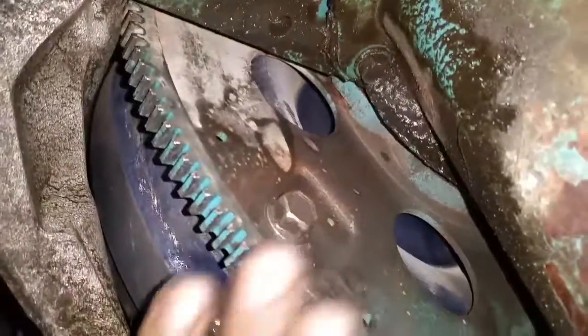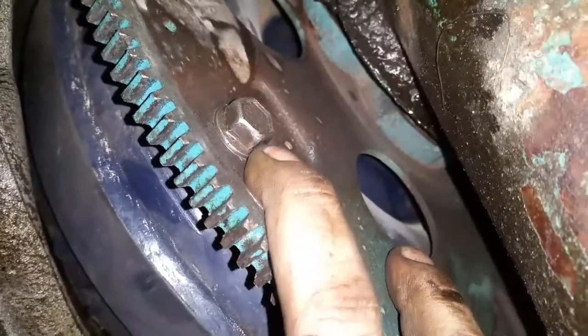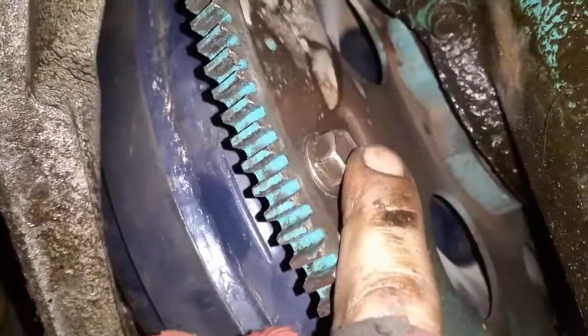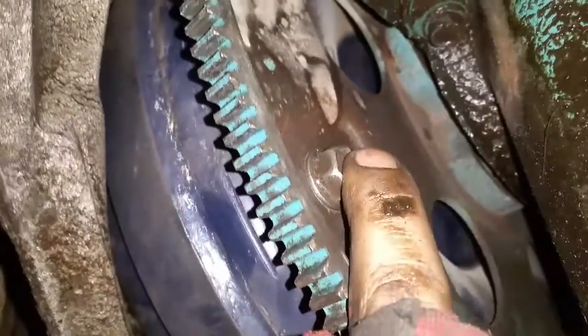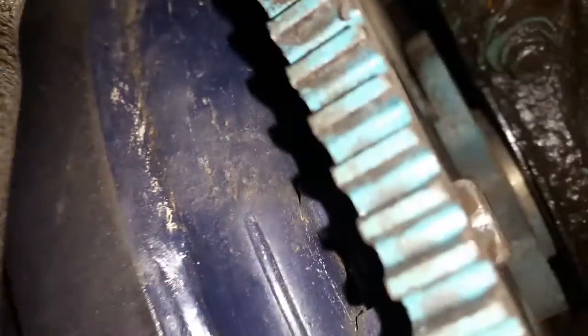A couple little notes here. When you're bolting the flex plate to the torque converter, these bolts — there's three of them — you'll want to use Loctite or something on those to make sure they're not going to come out. Start all three of them, get them close to being tight but so they can still wiggle a little bit. The holes they go into aren't perfect, so you want that little bit of slack until you can get all three started almost tight, and then you can turn the engine over one more time and tighten them all up. Make sure there's Loctite on there — you don't want those coming apart when you're driving, racing, whatever.